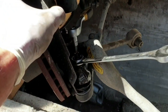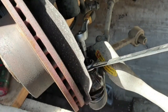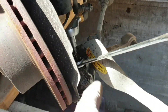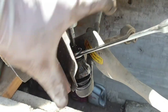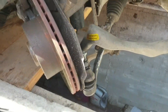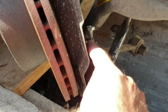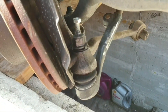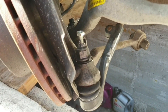This is the setup for the steering rack — you will need a T40, put it inside the bolt, and a 21mm spanner to undo this. Of course this side is giving me some problems. I welded a bolt in here because I couldn't take this nut out, and I hope it will be strong enough.